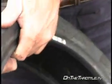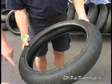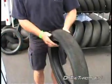And you can see from the two sides, slow entry here, so not very much disfiguration. Huge entry on this side. Given the direction of the tire, it's probably on the left side. Left side, yep. Because this is a counterclockwise track. So most of the load is on this side of the tire, hence the width of the band and disfiguration.